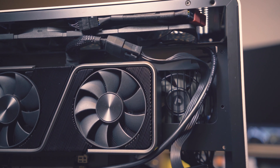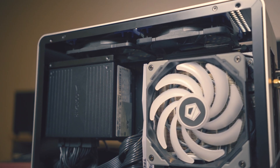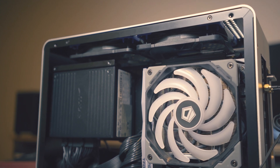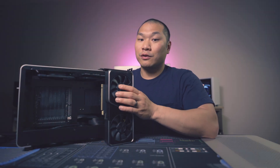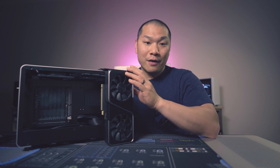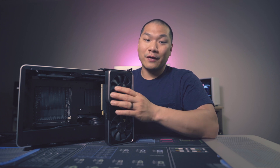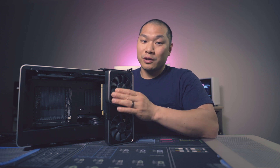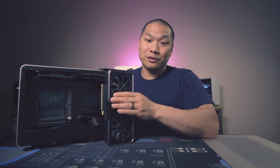The fan level adjustments and flipping the PSU did not work, but the case fan adjustments at least made this less of a fool's errand. It's good to know what works and what doesn't in an otherwise sub-optimal layout, and undervolting is actually a pretty good bet with this case. Done this way, the thermals are actually pretty good, and a sandwich-style case benefits disproportionately from undervolting because it's already running more poorly in the stock configuration. If you already have a card with a flow-through cooler, don't hesitate to try it in a sandwich-style case with an undervolt and the proper fan configuration — but just know it's not really the best home you can give it. Running this card with an undervolt in something like the NR200 would yield even better results.